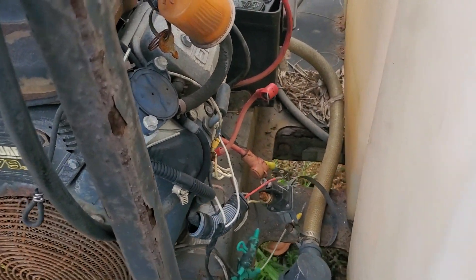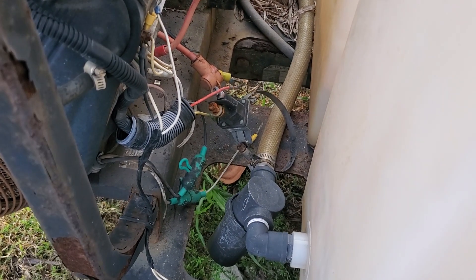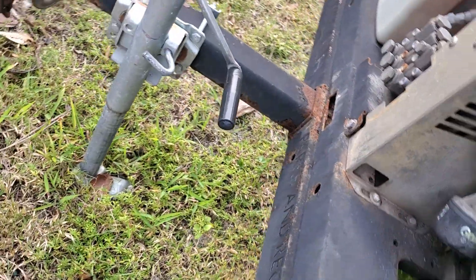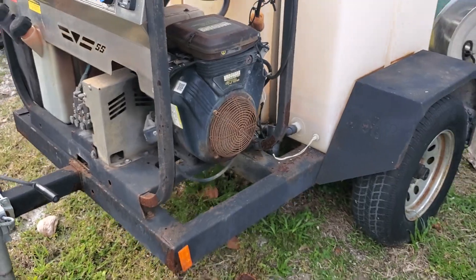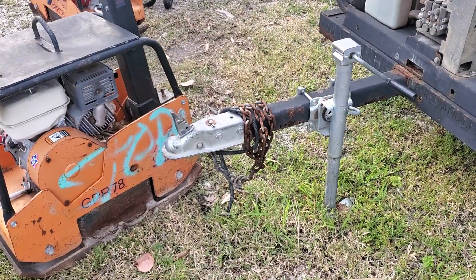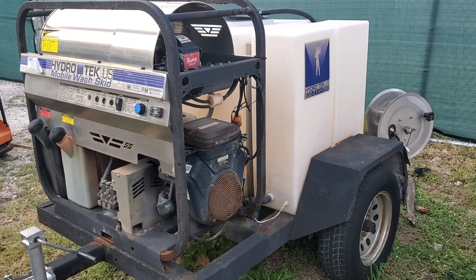The motor turns over. The battery is dead and it needs a new solenoid. Who knows what else it may need, but I just wanted to let you know up close what I'm looking at. It's got a regular hitch — I think that's a two-inch ball — and it appears to be complete. Good luck.